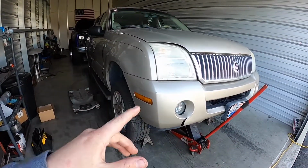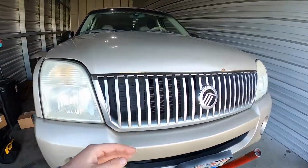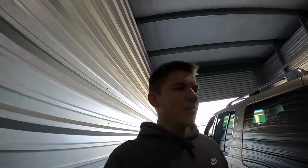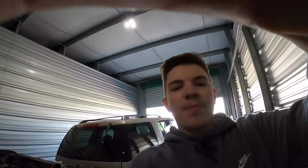And it had codes for throttle body, and it had an engine failsafe code as well. So after putting the throttle body in, I let it run for 15 minutes to do the idle air relearn, and so I went and drove it. Was still doing the same thing, but the engine failsafe code and everything went away. So I honestly think it has two underlying issues.